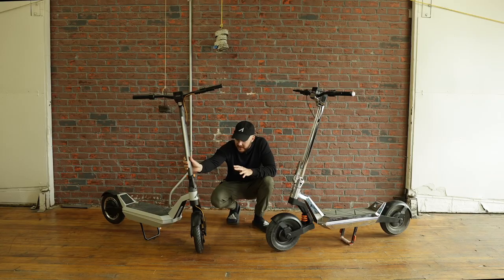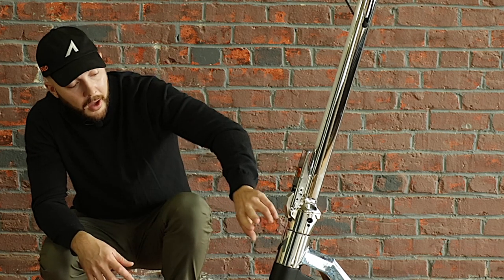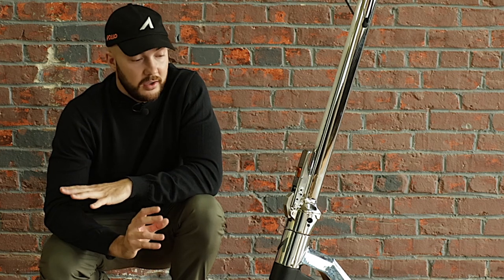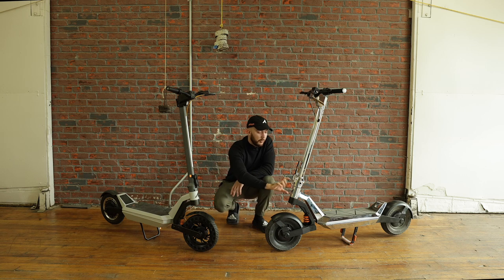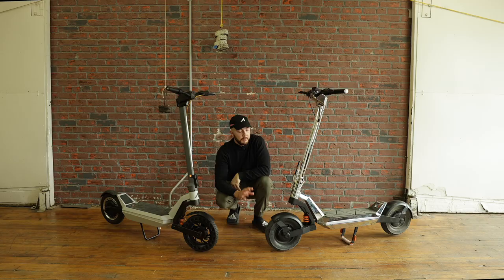The last point on the front end is the stopper. On the V1 it's a little screw stopper like on the Air in the City. But on the V6, since we had the chance to do it better from the start, it's a big block of aluminum inside the neck — so it's never going to snap. You could crash horribly and the suspension will still work perfectly. The bearing grade is also next level on the V6; we use Japanese NSK bearings, compared to the regular bearings seen in all other scooters. It feels right and will last extremely long.